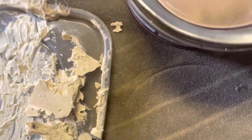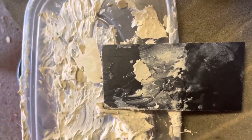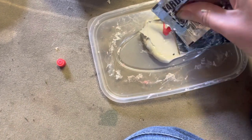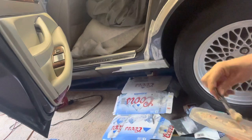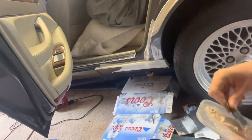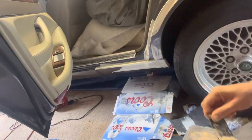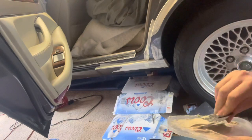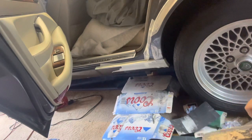A bit of a trick with these mixing boards: you don't actually need to clean them off. Just wait until it's dried, get it to crack, and you can scrape it off with a screwdriver like so — easier than trying to wipe it off. I'll mix up a brand new batch — just a smear of filler with a pea-sized amount of hardener — stir it up really well on the takeaway box lid. This time I'm aiming for a slightly smoother finish if I can. This stuff cures pretty quickly — maybe only half an hour depending on how thick you've applied it.